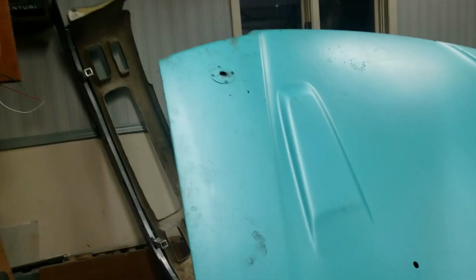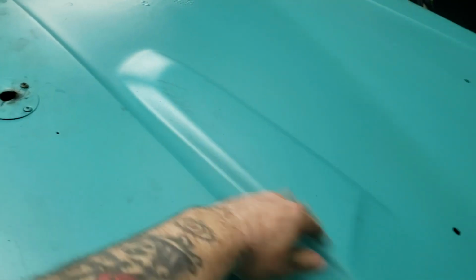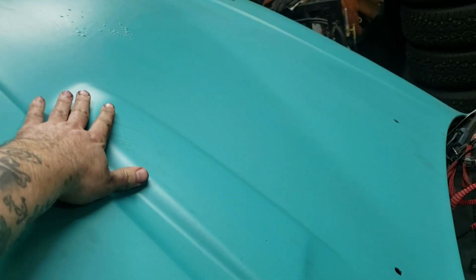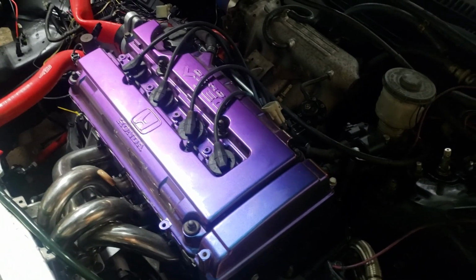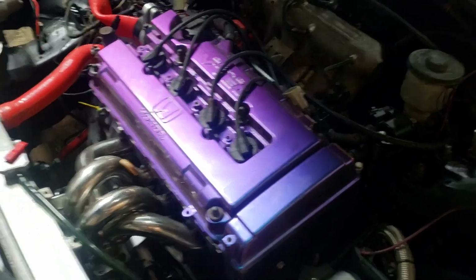It's definitely two days. And if you don't know, this is the classic JDM ZC hump. Back on the original, it was called the ZC motor, a 1.6 liter dual cam, one of the older ones, and the timing cover was a little high, so they made the extra hump to pre-empt clearance issues. Because now I have a hump. Yeah, that I need. And they do tend to rub. I've had it rub before. It's a super perfect setup there. I'm going to shim my hood just a little bit, and bump these up a tiny bit.